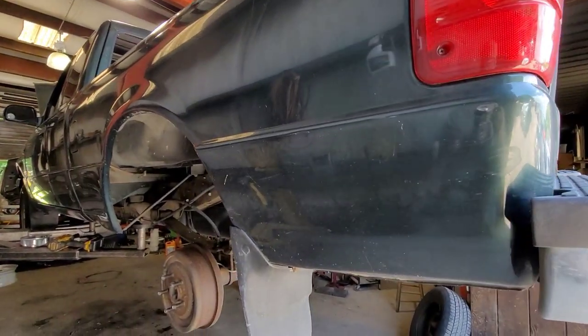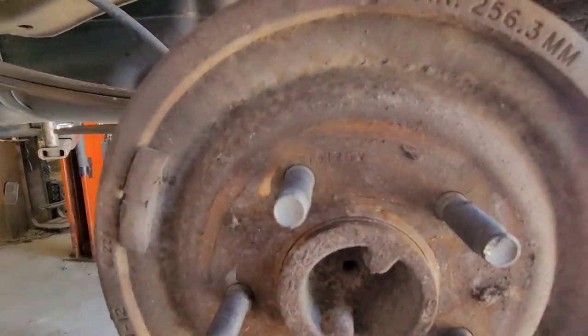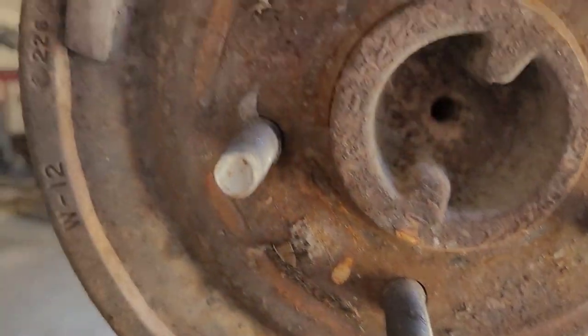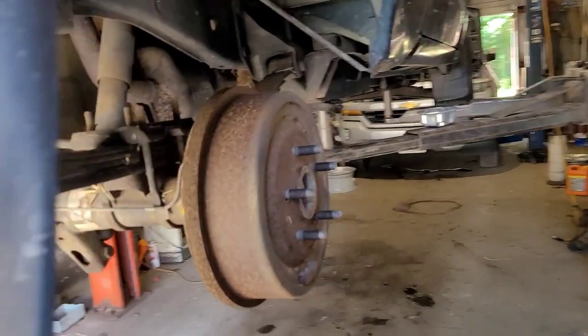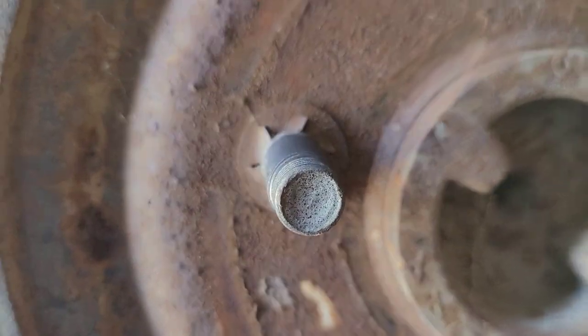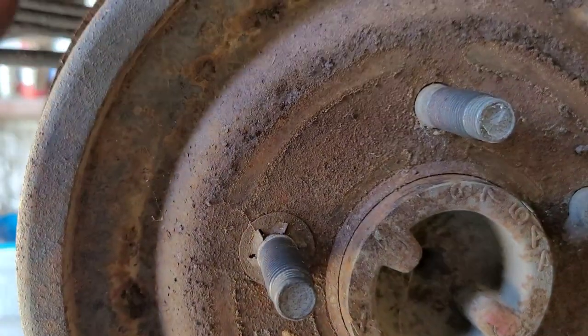So here's the vehicle — a 2002 Ford Ranger, so the vehicle's 20 years old. Now, you notice where the wheel studs are on this side — I'm telling you right now, this drum has been off at some point in this truck's life. But on the other side, I see an assembly line retaining clip. What they do is, when the rear end is assembled — usually outside the vehicle — the drum brakes are put on, the drums are put on, and they put those clips on to keep the drums from falling off. They serve no other purpose. You don't have to put them back on if you take them off.